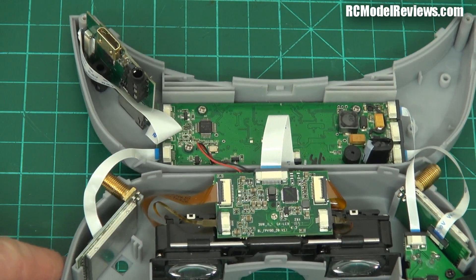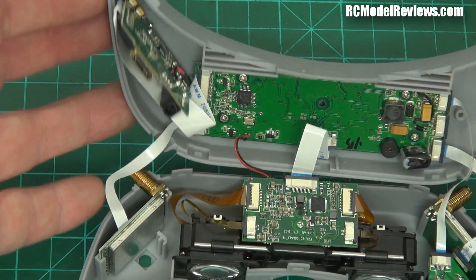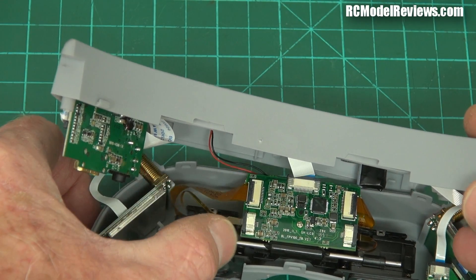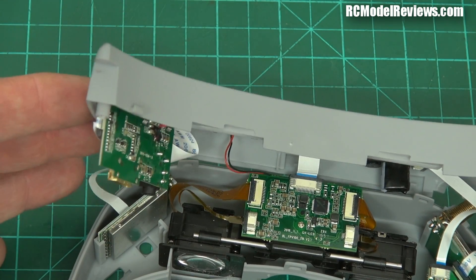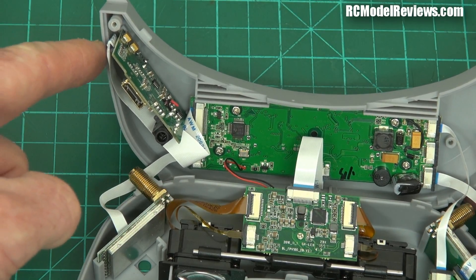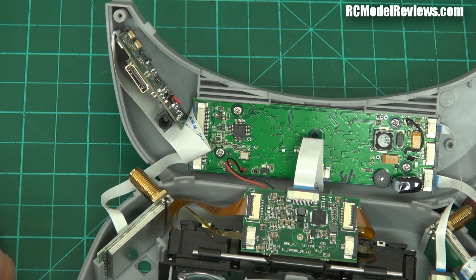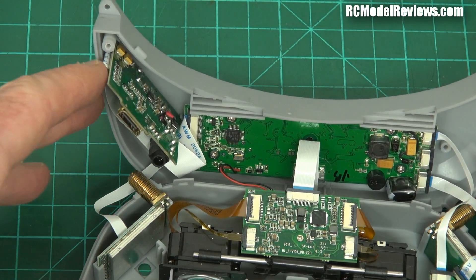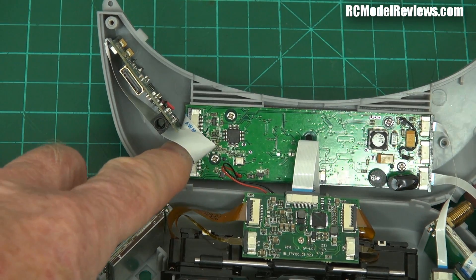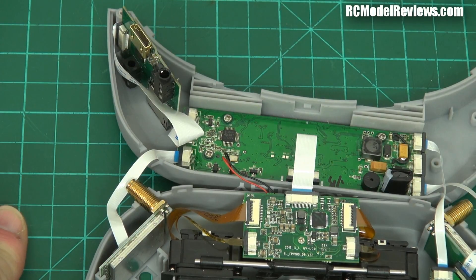Wait, don't go yet. I found out why the IPD is bouncing back. This flat flex here — the one that's been munted on the corner — when you put it down here it actually interferes with the flat flex as it goes to the left-hand screen. So this flat flex and the white flat flex are clashing, and that's why it's springing back. That's not very good. They should have actually run the flat flex around the other side of the board to keep it away from this area. Maybe they assembled it wrong. Now there's quite a sharp kink on it — I'm not going to route it the other way because it could actually fracture the flat flex cable. I'll just try to use a little bit of hot glue to make sure it stays right out of the way. That's a bit how you're going.